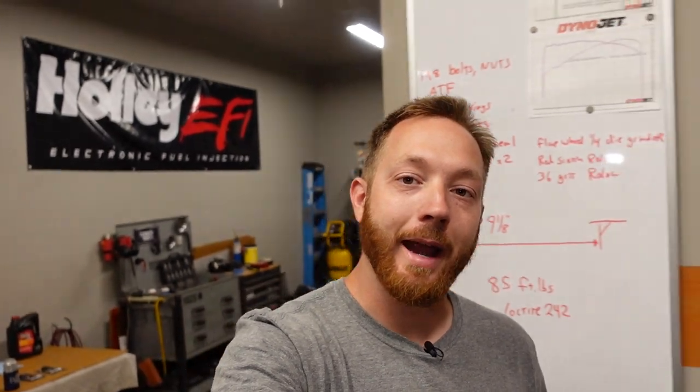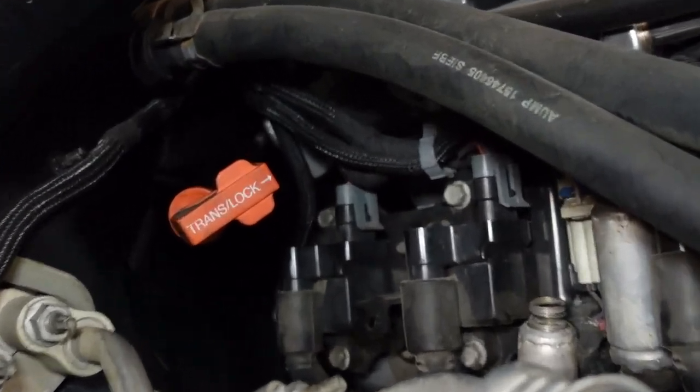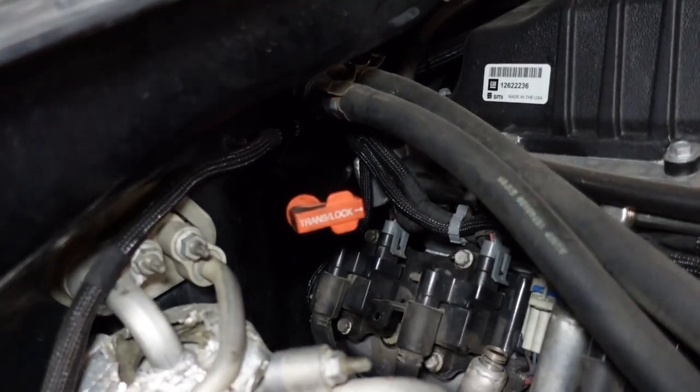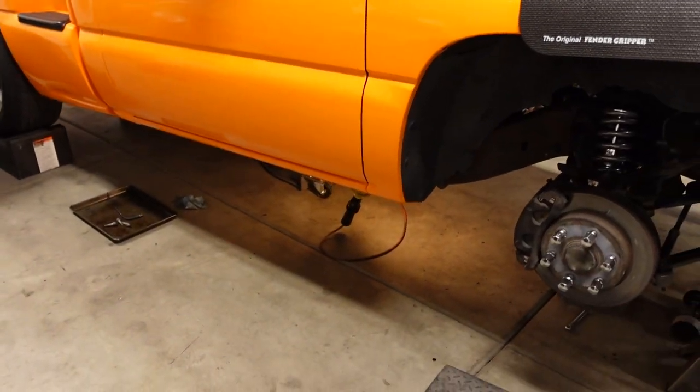It's actually the next morning. My major goal yesterday was to get the 4L80 installed in the truck and we accomplished that goal. Everything was fairly straightforward — just your basic R&R job. The only modification I had to make was with the dipstick because of the LSA supercharger. There's a little aluminum ear on the back of the supercharger that protects the fuel rail, and all I had to do was twist the dipstick just a little bit to get beside that. The crossmember is in place to hold up the transmission overnight. Everything with the DTR Fab crossmember works great and the best part is I didn't have to do any cutting or welding.